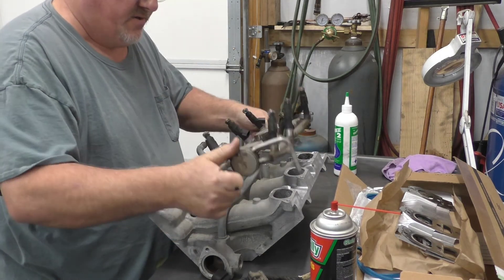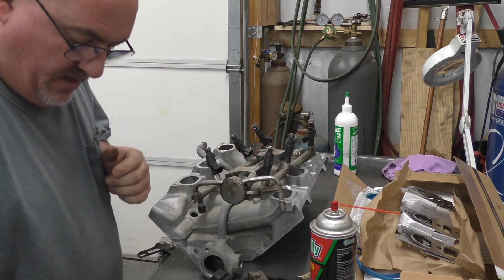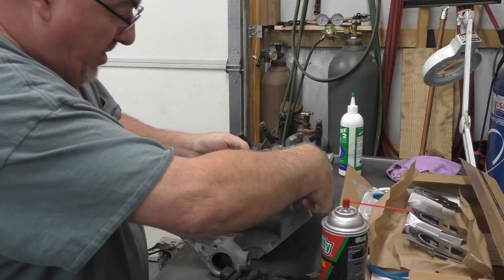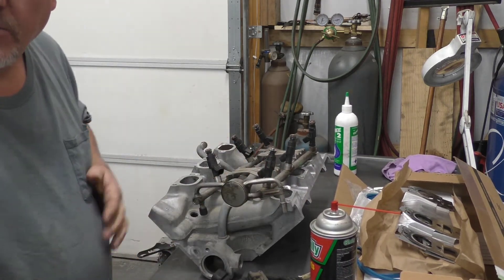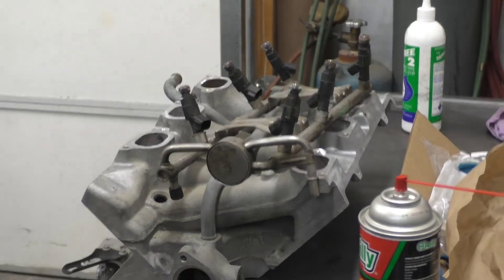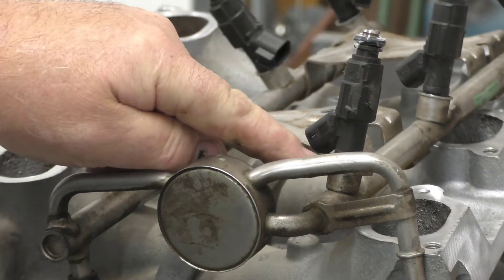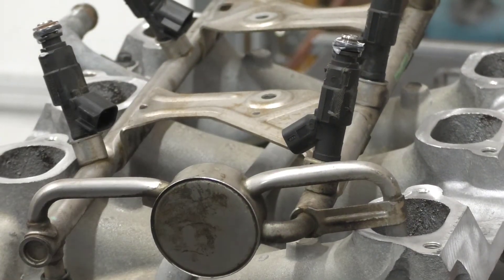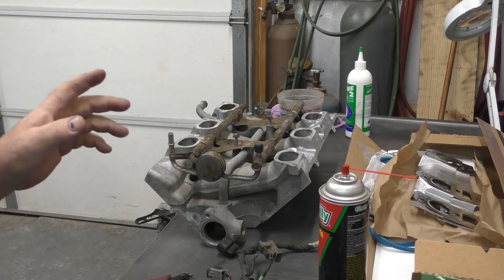Okay so that's going to line up — I am good. Let's get the clips on. These clips I took off of them — I'm gonna go ahead and pause the camera. These will go just in here so the whole injector does not fall out of the top, just like that. They go right here, right there. I'll go ahead and put them all on.